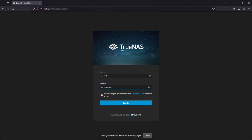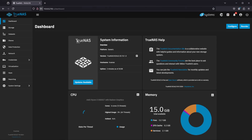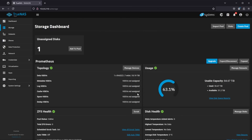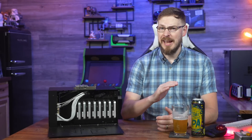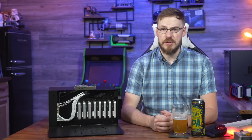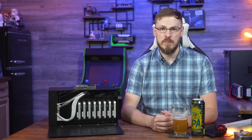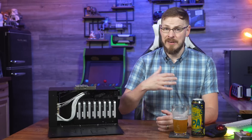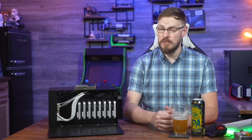For this video, I have 8 20TB Seagate Exos drives installed, and I fired up TrueNAS to test everything out. These aren't blank drives either — they actually came out of my Storinator AV15 server and have about 60TB of data written to them. The 2.5Gb RealTek NIC was recognized immediately by TrueNAS without any problems, and I had no trouble maxing out that bandwidth to the tune of around 285 MB/s in sequential reads and writes. Obviously not a very scientific test, but some solid results nonetheless.